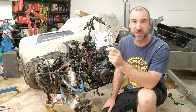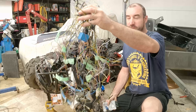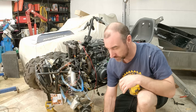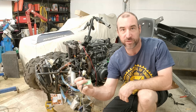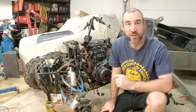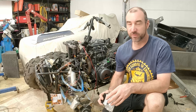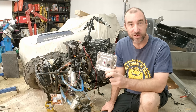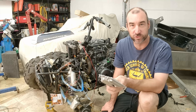This is a standard KTM ECU. I had all this wiring, I had the dash, and I even hooked onto a plug I found on it and hot-wired into it to get OBD2 and use my Autel scan tool trying to get this thing running. The way this ECU works is it needs to meet a certain amount of conditions before it'll allow the bike or engine to run.